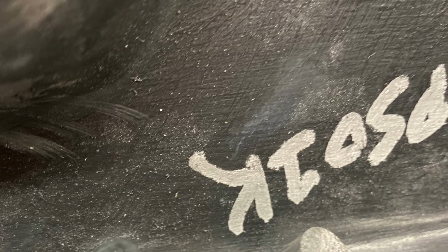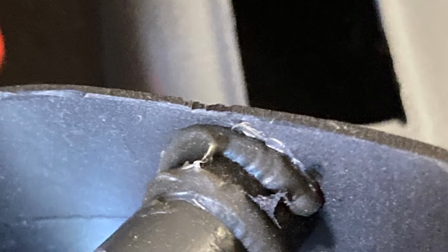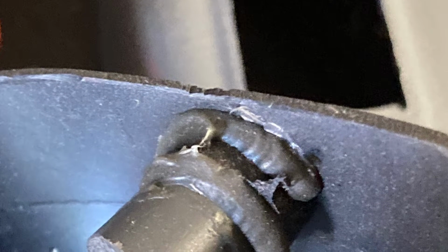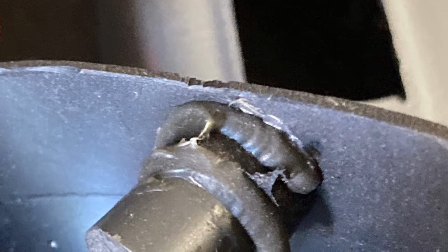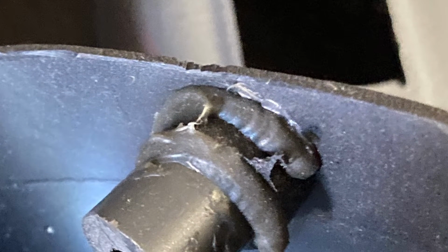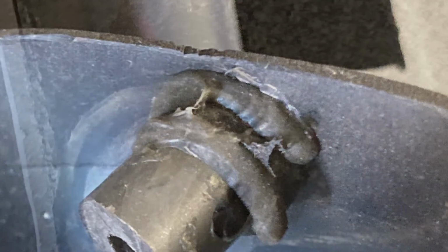And because people are large, and I'm one of them, they have to be very stout, these plate covers. Enter the fronts, and that front peg is the most important one. Anyway, you've got to grind it down. You've got to re-epoxy all these mounting holes. You've got to shave that off to get the geometry you need to make it hug the seat tightly so it won't move and break off. And that's what I had to do.